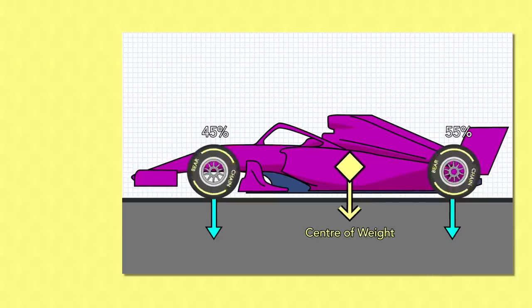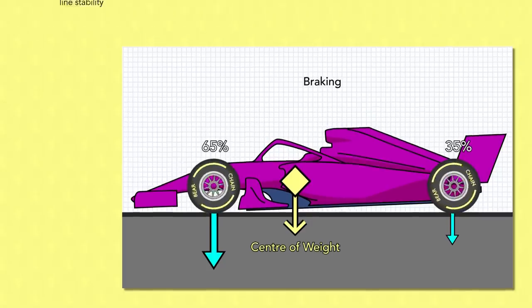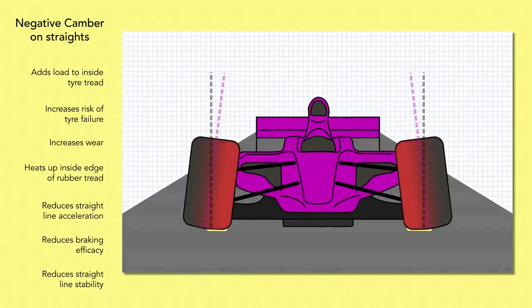What is critical is braking. Braking is maximally critical in straight lines and during braking the load is transferred towards the front tyres — the front tyres that are cambered and leaning not on their full tread but more to their insides. Too much camber up front can have a big effect on your braking ability and the effects from braking on your tyre's durability.